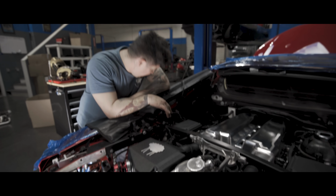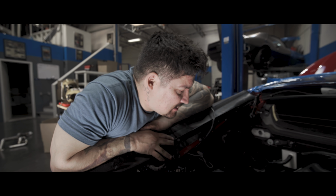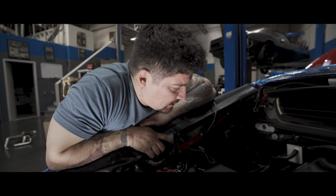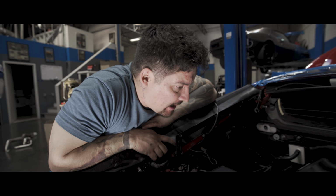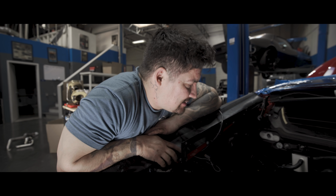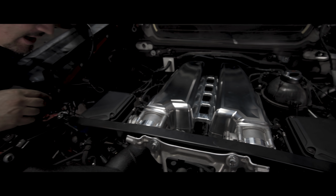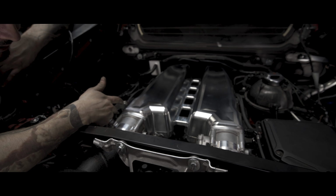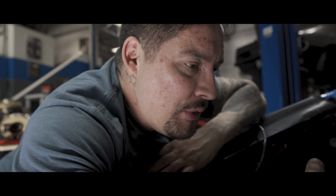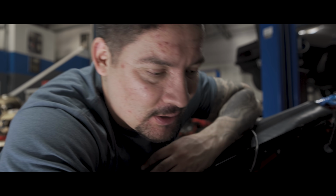Anyways, this was kind of cool, a little different. I spent the day yesterday figuring out all the pros and cons of this intake manifold. Like I explained earlier, with all the charcoal canister evap valves, we got rid of one of them, relocated one of them, and plumbed all that. So I was still able to maintain half of the OE stuff and still give it the race car theme. I did all XRP hose ends that go to everything, so it's not barbed. The only hose that's barbed honestly bothers me, and I might replace it. Every hose is XRP other than that one.